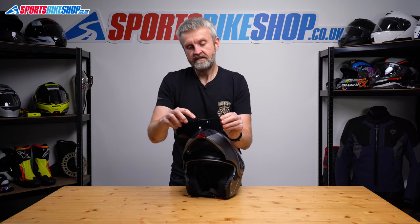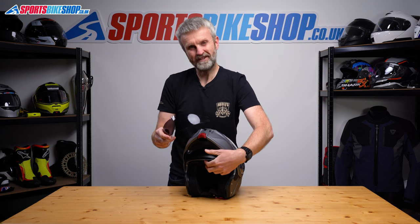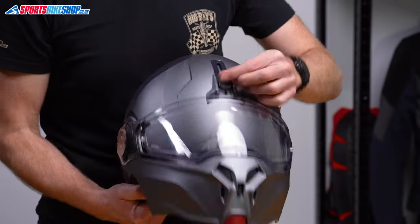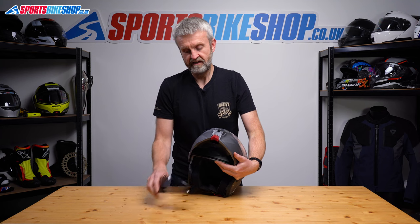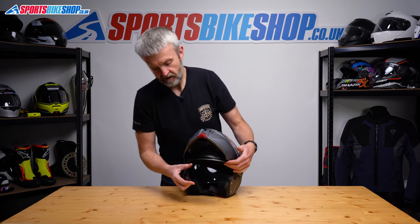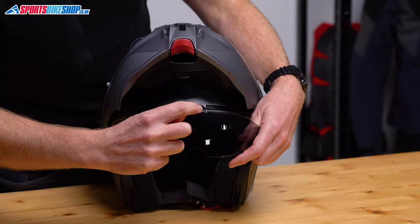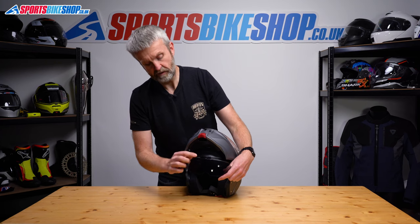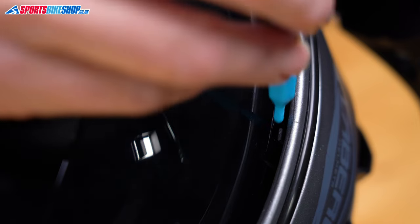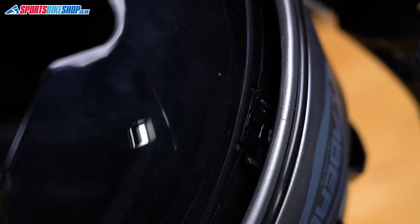This tab on top hooks into another tab that comes down when you operate the switch. If it doesn't come off cleanly, you need to get in there and separate the square section from that tab. I find the lid from a biro is perfect for doing that — you don't run the risk of scratching it with a screwdriver. Just poke something in there to get them separated.